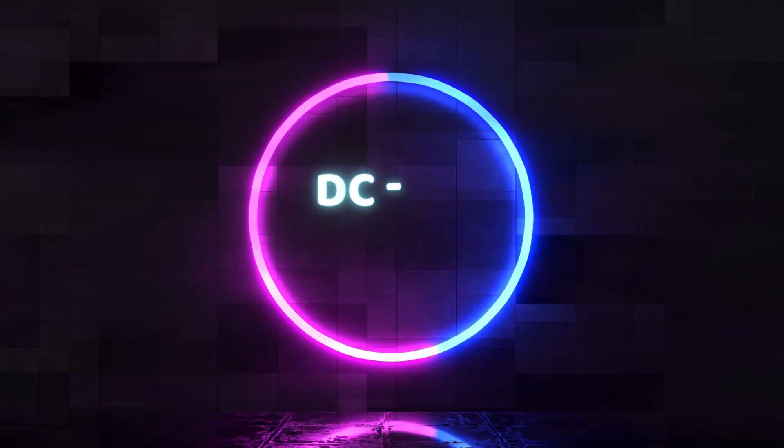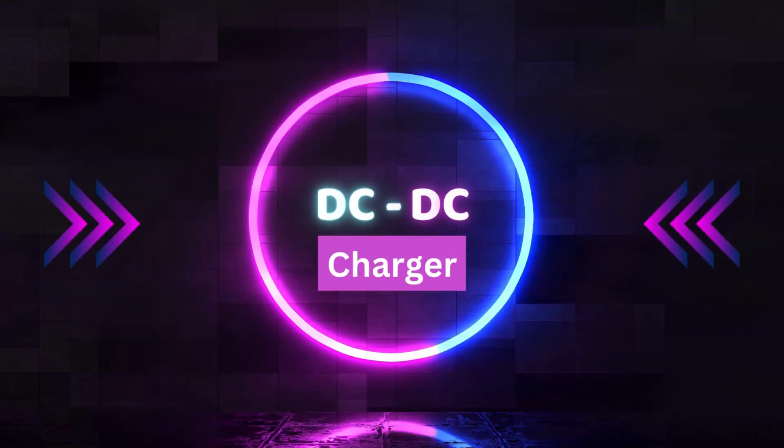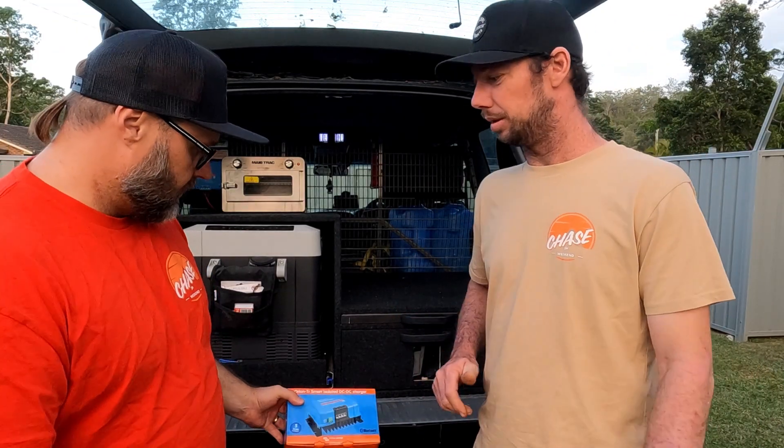So the whole time you're driving on the highway your second battery is not getting any charge. The other thing that happens is they don't put out as much voltage as the old-school alternators, so your voltage turn-on point — you might not even get there. There is a workaround, and it's the preferred way to charge a battery anyway, and that's with a DC-to-DC charger. Let's find out how it works and what it does.